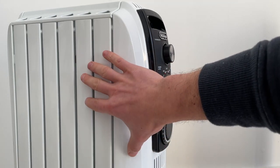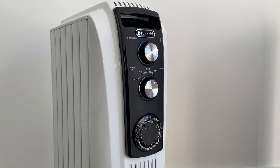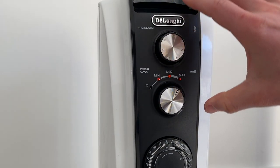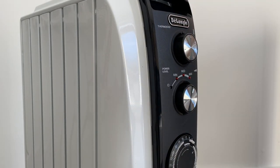As for the DeLonghi, I like this one because it has really nice build quality — it's super quiet and very dependable. Reviews around the web are very positive; it's not just me. It sells for about $115. If you are interested in an oil-filled radiant space heater, this is a really nice one, but it's not a replacement for a ceramic or fan-based heater — it's a different type of solution. If you want something to sleep near, or you need frost protection like the frost protection setting we discussed, you need an oil-filled heater like this. You do not want to do that with a ceramic or fan-based heater. For some scenarios, this is definitely the right choice. You have to decide when a space heater is the right solution and when it's time to put in a full permanent heat solution.